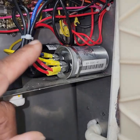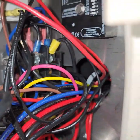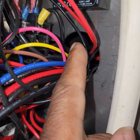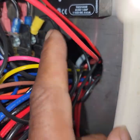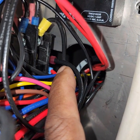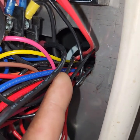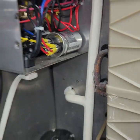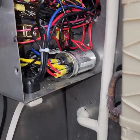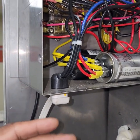What someone did was — this wire goes over to the right side of the contactor. You can see there's a red wire that's connected to the right side of that contactor back there. When I opened this up, this wire right here for the pump, it was just dangling right here. It was just hanging — it wasn't even connected. There was a service guy out here earlier, so I'm just assuming that he forgot to put that on. I just wanted to show this to you because this is a good chance to show you where those pump motors go.